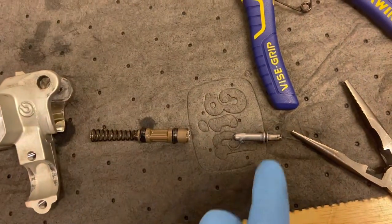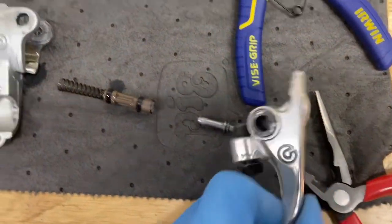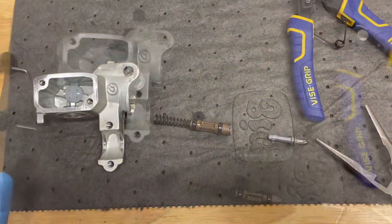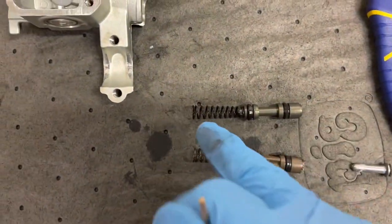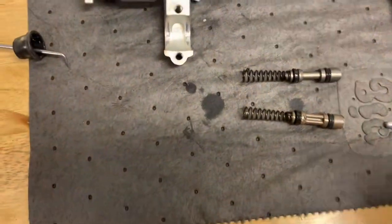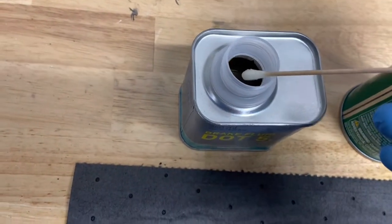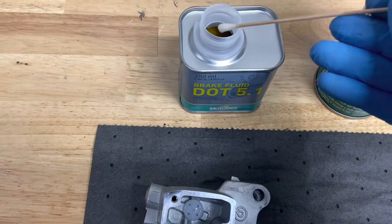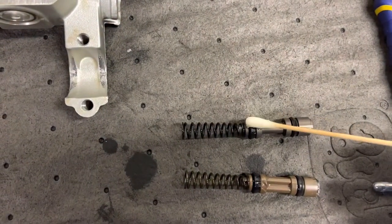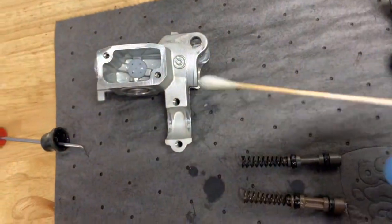This was the little pin that applies from your brake lever. So I'm going to clean it and put it back together. I took out the new parts and laid them all out in the same order they go back in. Now I'm going to take a Q-tip and dip it in — I'm using the 5.1, you can also use .4 — and nicely lube up the O-rings as well as inside the bore.